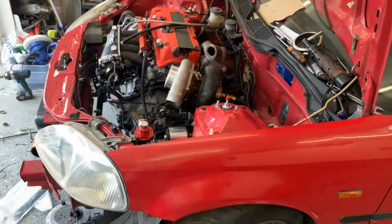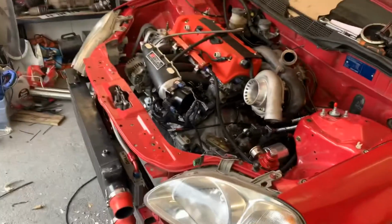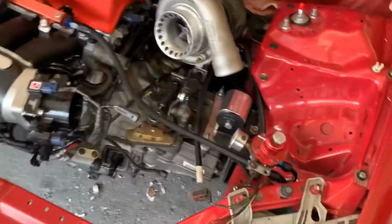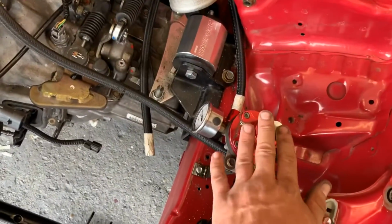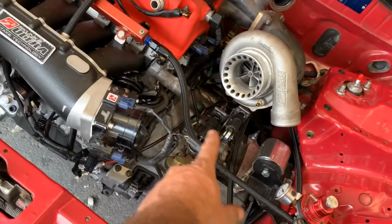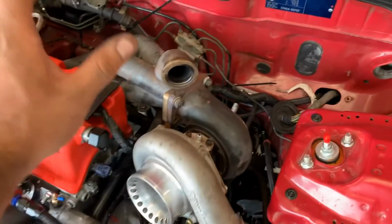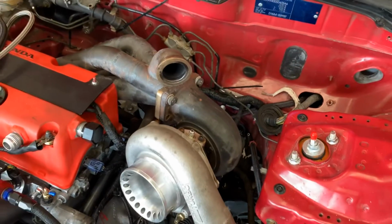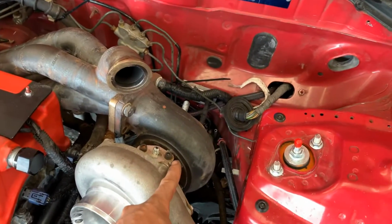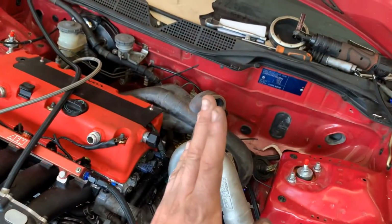I'll run through what I've got done and then I'm going to wrap the video up, because this video is going to be hours otherwise. So, as you know if you've gone through the whole video, just a little recap on what we've done. We've got the fuel return system set up, a little bracket made, that's all good. I've got the turbo return sorted, so I've got a new return done on it. Got the turbo clocked a bit better now, because before it didn't sit central because of the way the gearbox was on the other return, but I've got it sitting perfect now.